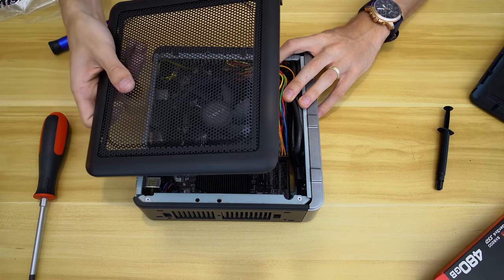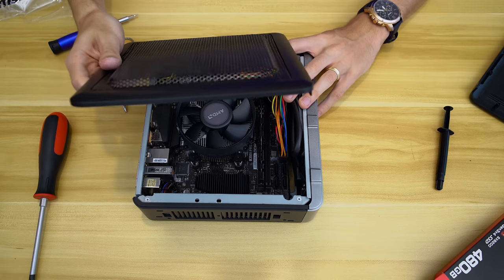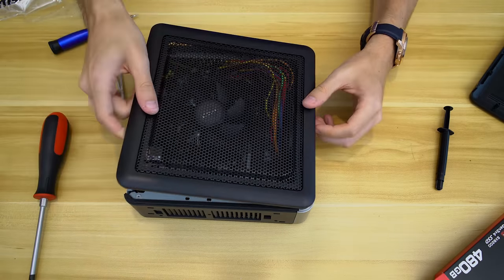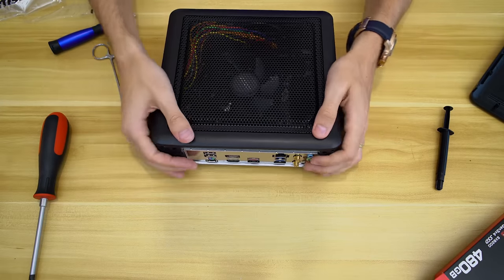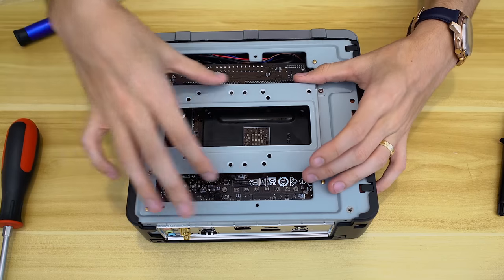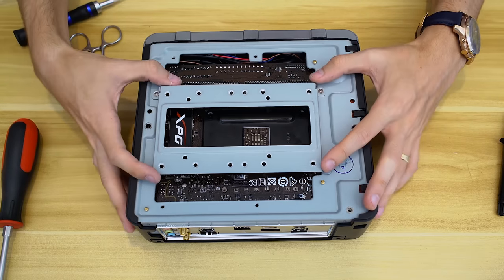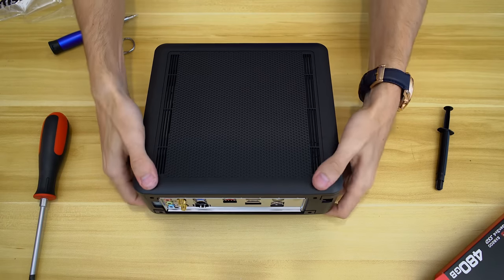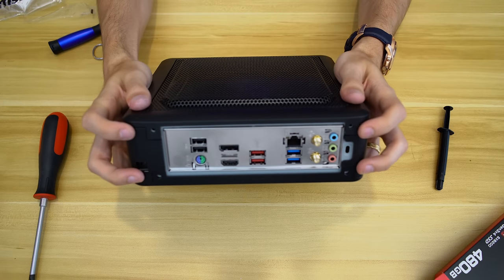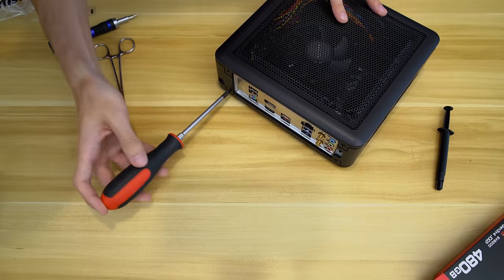Next, put the left side panel on. You can see there is literally no clearance at all between the top of the CPU cooler and the mesh panel — luckily Antec indented it just enough for the Wraith Stealth cooler with the removed plastic cover to fit perfectly. Secure the front of the panel first, then push down on the back side until you hear a few snaps. There's also a dedicated tray here for SATA 2.5-inch SSDs secured with four Phillips screws, sitting discreetly under the motherboard. Finally, four Phillips screws on the back next to the rear I/O plate keep the panels in place.